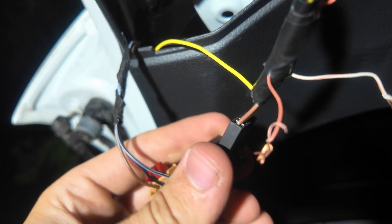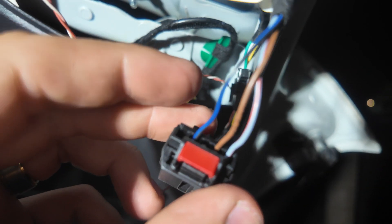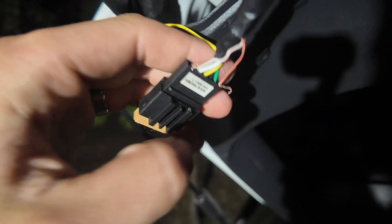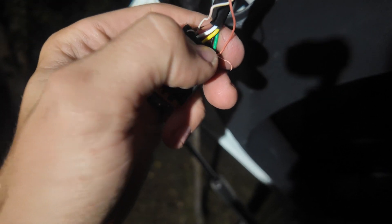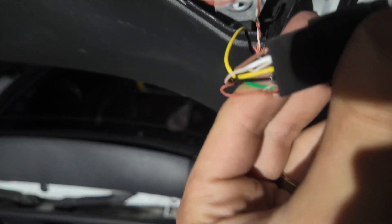I'll leave a link below to some Amazon connectors you can use for a cleaner result. On the right inner taillight, don't move any pins. The white wire going into pin 4 on that side connects to the blue and black wire at pin 4 on this side. Then pin 1 — the orange wire — connects to the gray and red wire at pin 1 on the other side. After troubleshooting I found I had the jumper cables on the wrong pins. The brown wire is on its own, white goes to white, yellow is on its own, black is on its own, and the orange wire goes to the green, passing through the panel to the other side.